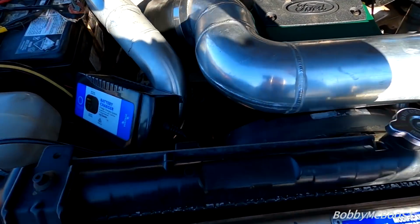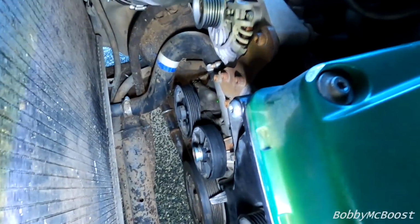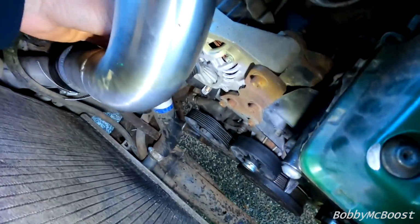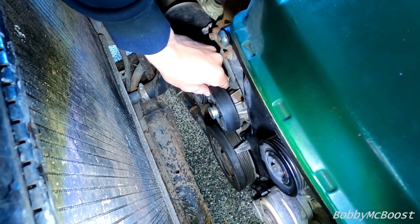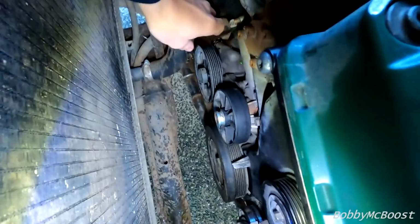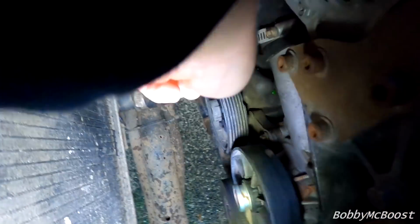I reckon the power steering pump is what's got the little bit of wobble in it. I got all of 3 kilometers from where I put the new belt on it and it came off, snapped it, wrecked it. So I was pretty pumped on that. When I put the new belt back on, everything seemed pretty good. Like the alternator itself, good, everything's tight. That one's pretty good. I've had it on Freddy where the water pump was a bit out. Obviously it is now, and that's what broke when it bound up, which sucks. But I reckon maybe this one was what was loose. You can see it's got all this movement now.